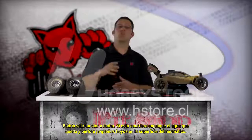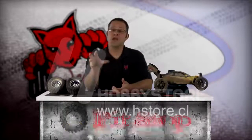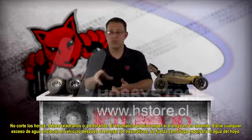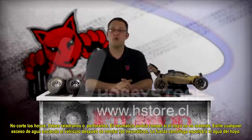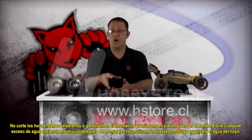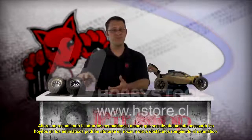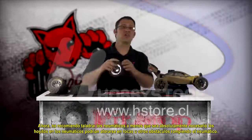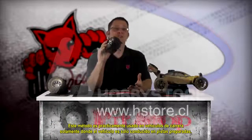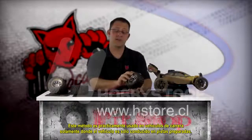If this happens, rinse out the stale water and drill small holes in the surface of the tire. Do not cut holes. You must drill or punch them. See, the tire may tear if the hole isn't round. Squeeze out any excess water and run the vehicle after mounting the tires. Centrifugal force will throw the water from the holes. Now, I don't recommend drilling tires unless absolutely necessary. The small holes in the tires could snag on rocks or other obstacles, tearing the tire. This method is mostly used on race-only vehicles, where the vehicle is only driven on groomed tracks.